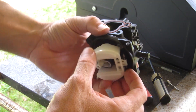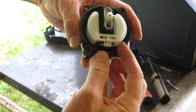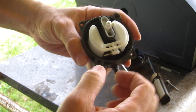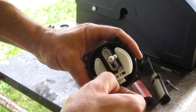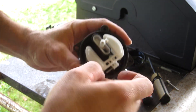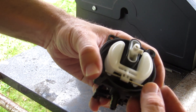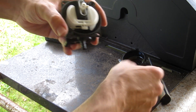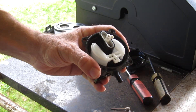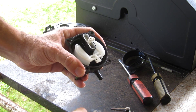Let's just say it wasn't working. All you'd have to do to replace or clean it out — you see this pin — it just slides out one way or the other, doesn't matter. It should come out fairly easy. If you try to grab it with needle nose pliers, be careful that you don't gouge it up. I use the basketball inflation needle for a lot of things, and this is one of them — you can push that pin out. If you nick it up with pliers, the operation of your float is not going to be smooth and you're going to have more problems.